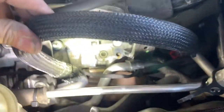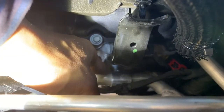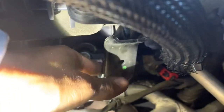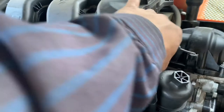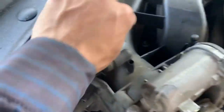Now since this side is a little bit harder to get to the 13, what I did was I didn't take out the bolt completely. I just moved the line out a little bit to give me some room to get my wrench in there and loosen it enough to get enough room for this bracket to move out of the stud. Next I remove the intake manifold bolts - all of them, one through seven.